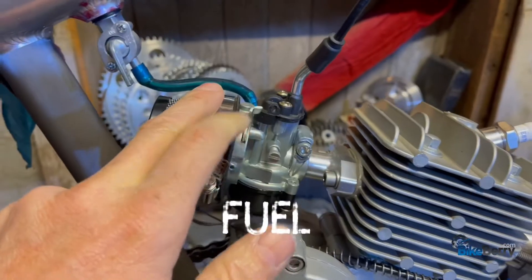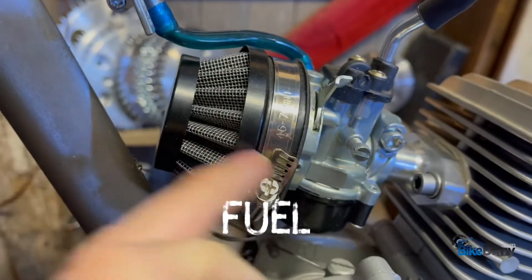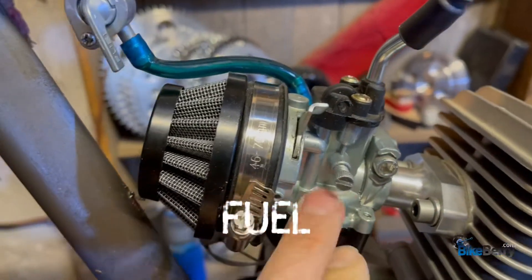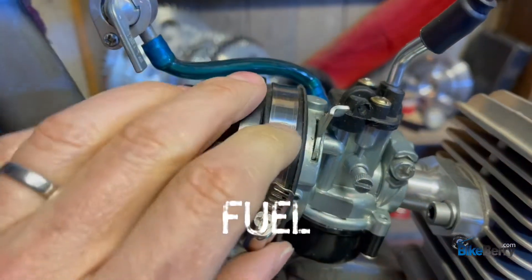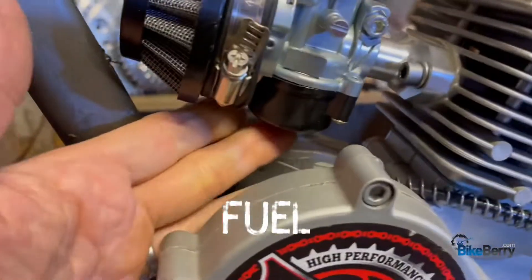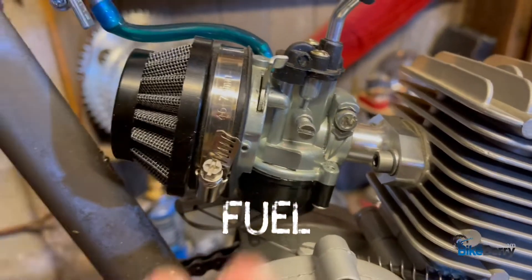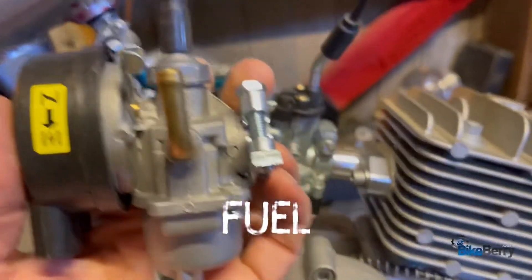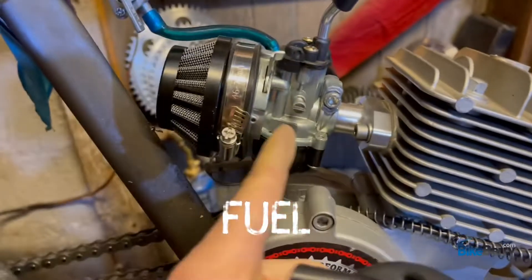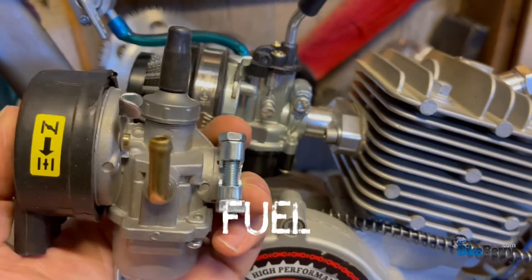I like to use clear tubing so I can see if fuel is in the line and coming out. If it's not flowing and the petcock is on, something is plugged up and you may have to go further. If you have fuel and your choke procedure is good, sometimes you may need to take the carburetor cover off to see if fuel is getting delivered inside. If it's dry, something is wrong — maybe a fleck inside the needle inlet. Further investigation is to check if the bowl has fuel in it using the drain valve. When I can't figure out what's wrong with the carburetor, I'll swap in a second one I've already set up and ready to go.